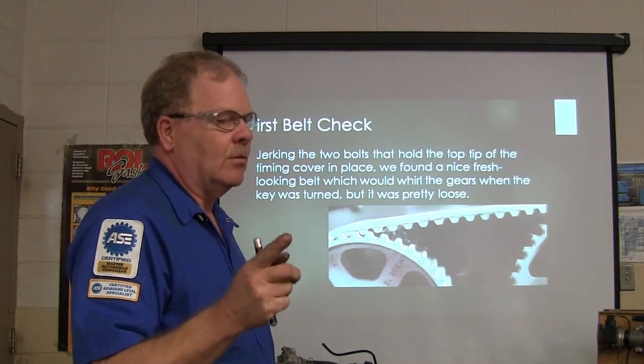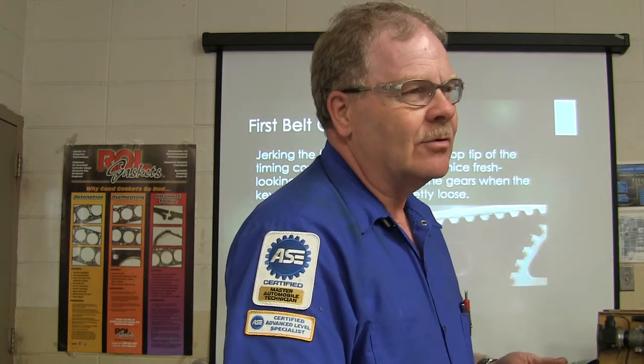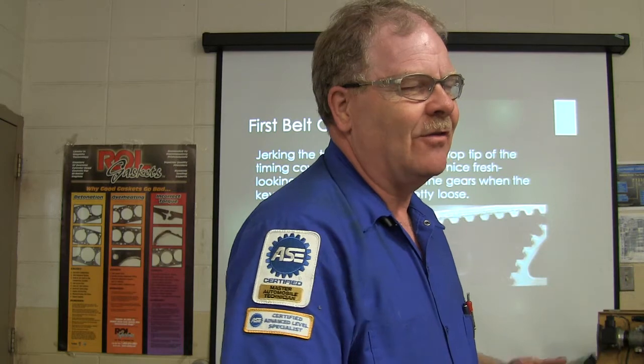Now, I'll tell you what the deal is. Some of these cars, like for example, a Kia Sephia. If a Kia Sephia has gone past the timing belt replacement interval, it's living on borrowed time. Because if one of those jumps time, it beats the crap out of the valves and they start snapping the heads off, or they hammer around in there, bust the pistons and mess up the cylinder. You're putting an engine in it, man.